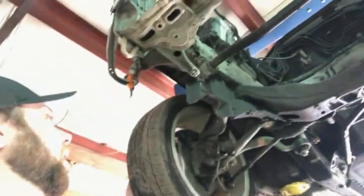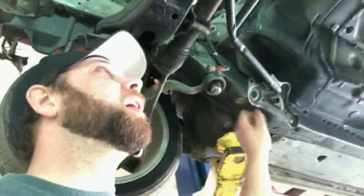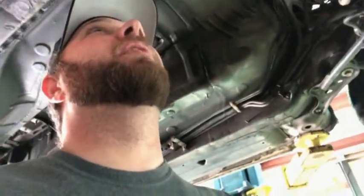Like all the right front suspension on this thing is broken because this is what came off the other car. Probably gonna drop the steering rack though, because I'm pretty sure the steering rack's damaged pretty bad in the other car from jumping it. But either way, we can pull the steering rack out in the field and it won't be too bad. It's literally just 2 bolts here, 2 bolts here, the slip there, and then the tie rods. I'll probably just pull this rack with the tie rods. That tie rod's already loose. That one still has a cotter pin in it.